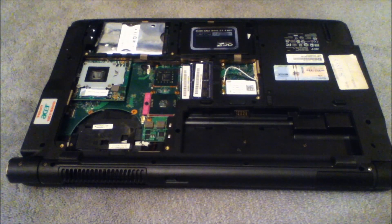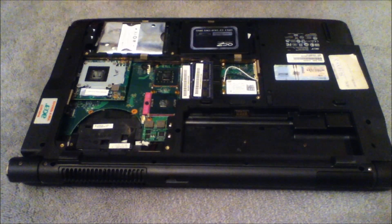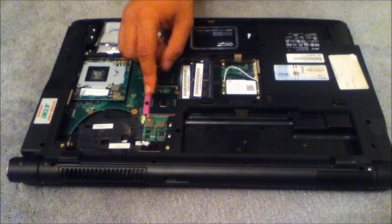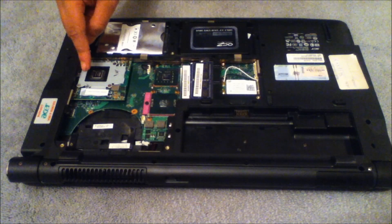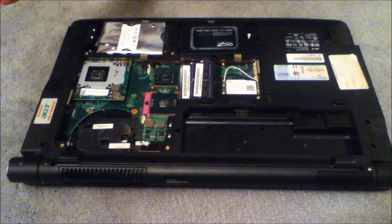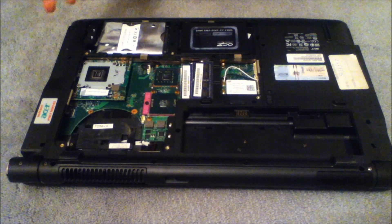As you can see it's actually quite shiny now — it's quite a nice reference for how shiny the others should be after you finish cleaning. One important thing: you do not want to apply a lot of pressure when cleaning, that's not good. Also try and avoid getting any thermal compound in the green circuit board area. On my Nvidia chip they actually put a protective seal, which I suspect is because the factory application wasn't done very cleanly.